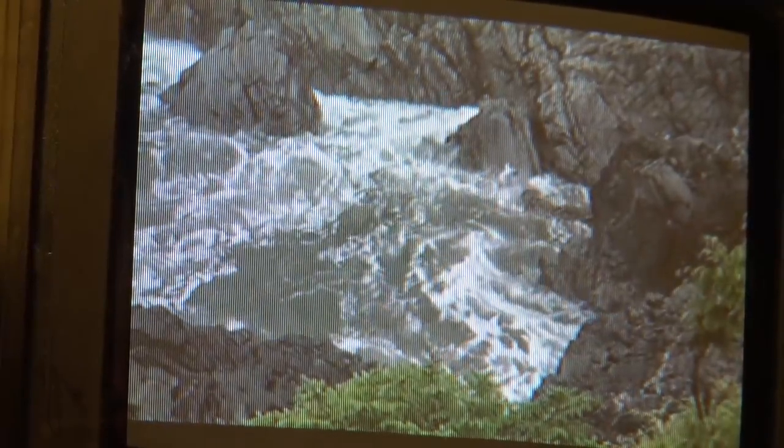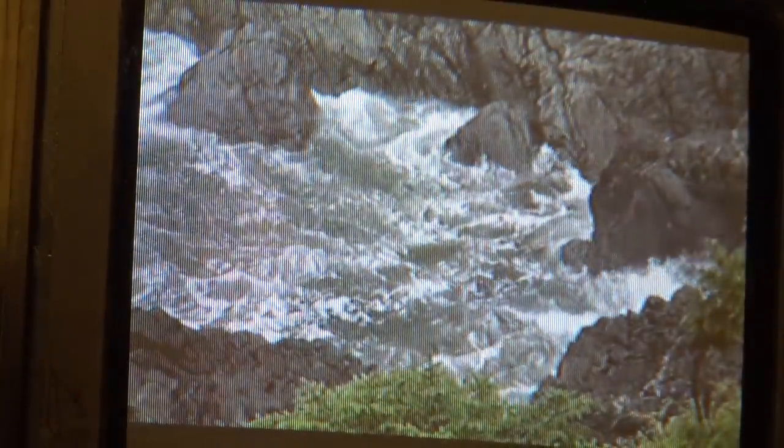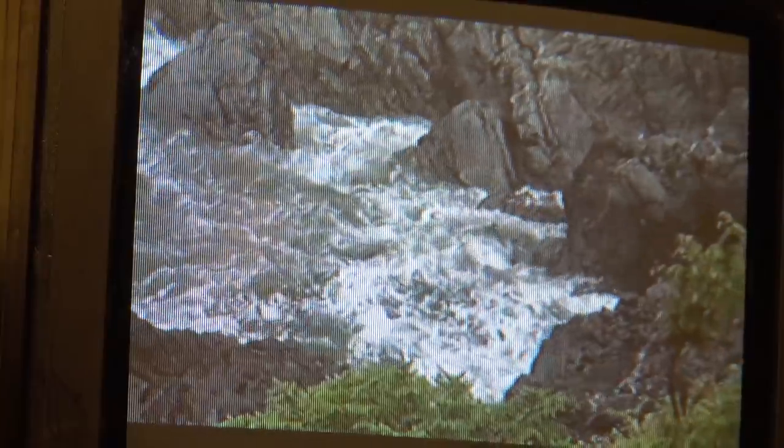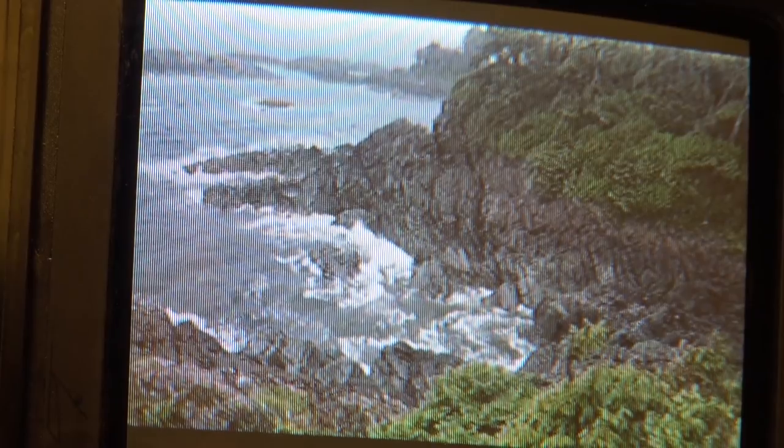By comparison, you can see this one here uses an inline gun — you can see the colors all in a line. This is an inline gun CRT 5-inch, which was another small one. I also have my Sony 8-inch Trinitron on here. I'm getting a bit of interference just from reflections in the room; if I move the antenna around a bit it will improve. It's great to have one of these little transmitters for playing around with old analog TVs so you don't have to actually hook up wires to them, which is always nice. It gives you an idea what type of picture the little tubes can deliver.